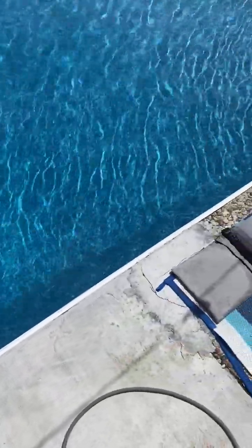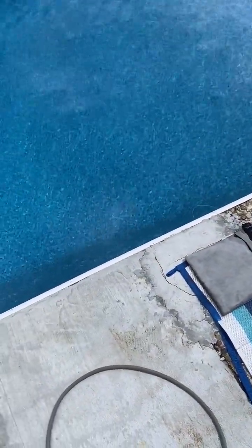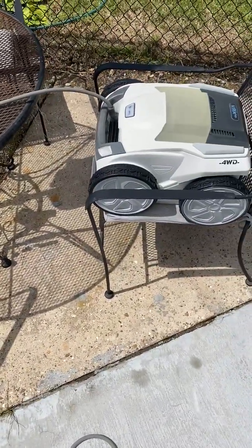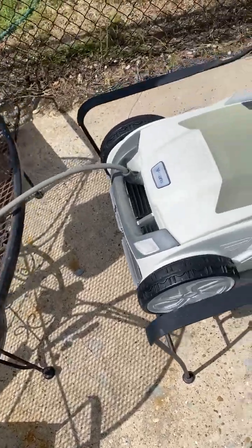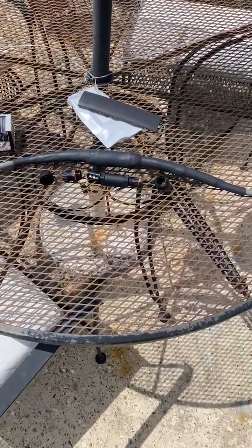I don't do that anymore. My pool stays pretty clear and clean — I'm in Louisiana. I don't run my pump 24 hours a day; I run it for about 11–12 hours total in two spurts: 11 PM to 7 AM and then 1 PM to 4 or 5 PM. That keeps the water clean so I don't have to run the robot as much. Now when the robot is done, I take it out of the pool. Not leaving it in the water may help prolong its life, since there's no chance for water to leak into the motor control block on the underside or into the swivel.